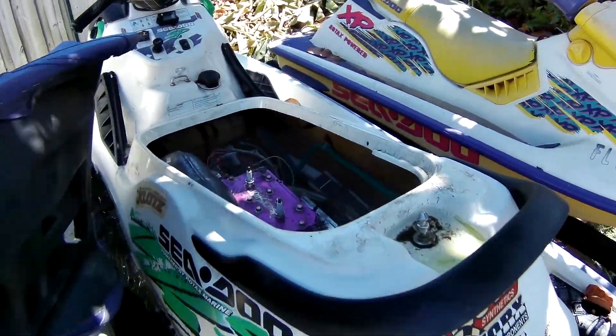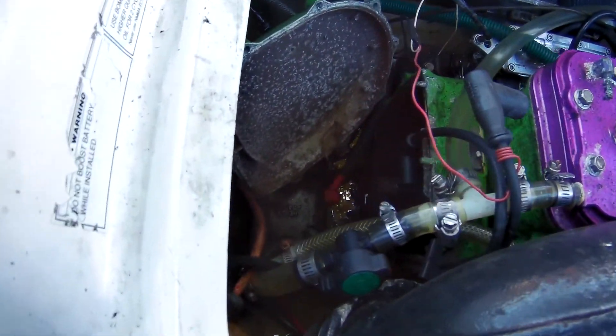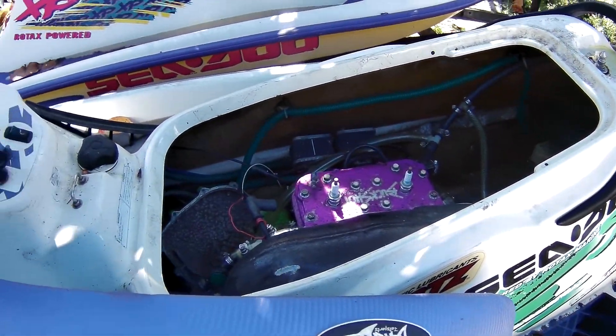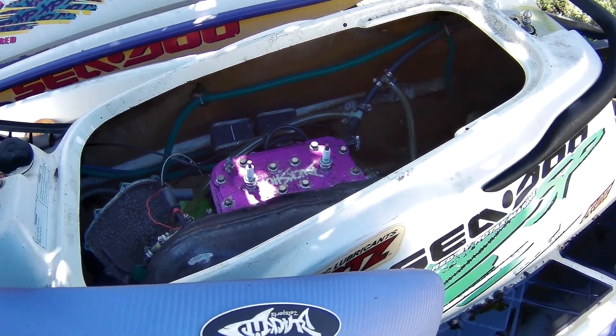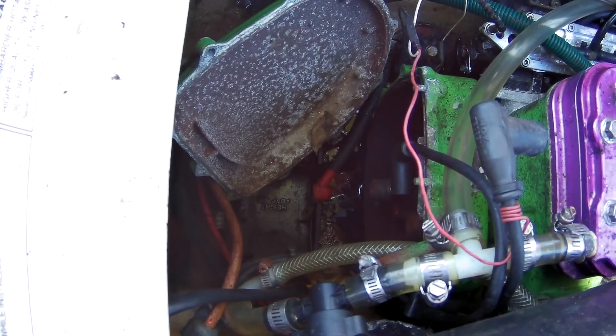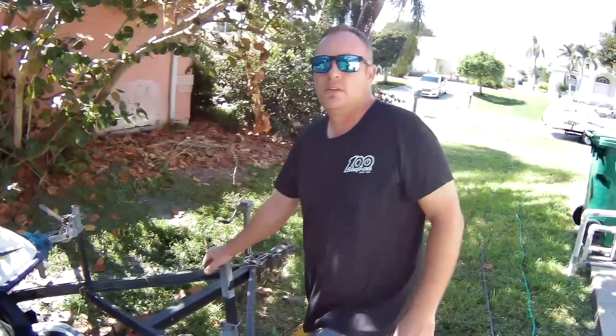Here's what's happening — it looks like a mess because the motor's locked up. Unfortunately the WSM crank finally failed. The last time I was out I had that motor wide open and they said it wouldn't fail even though it's modified. Ben said it was my fault for not lock-tightening the flywheel onto the crankshaft, but it took the whole end of the crankshaft right off. Me and Ben went out, it wasn't running right because it was off time, I sheared the key, brought it home, but I thought we had impacted it.